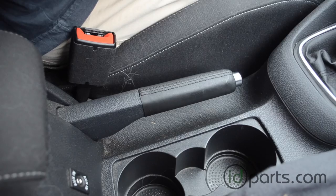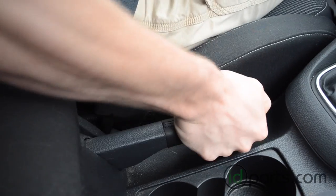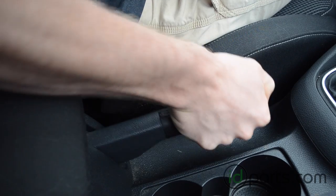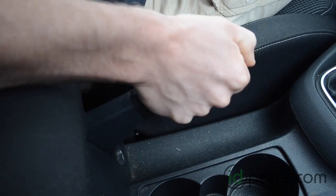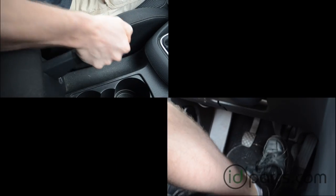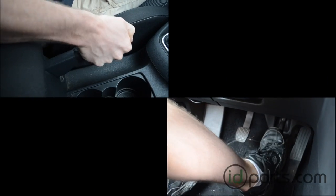This car is pretty good. Before we go for a test drive, we need to pull the e-brake handle up and down numerous times — you'll notice the resistance increases as you pull it. At the same time, push on the brake pedal. The brake pedal will be very light the first time and it'll stiffen up as you go. After getting the brakes back together and putting the wheels back on, we took the car off the lift and now we're ready for a test drive.